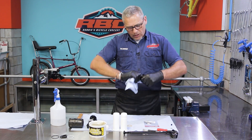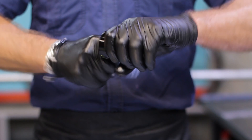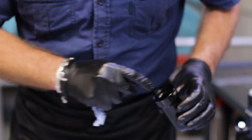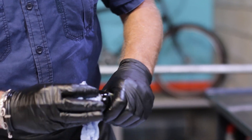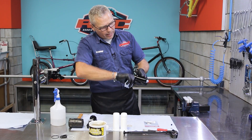To further finish this off, I want to take my cloth and clean out the air can, making sure it's nice and clean. I'm also going to look a bit further into the air can to make sure there are no scratches or any signs of wear and tear inside. If I'm confident that it's good, I'm going to go ahead and assemble the main air seals.